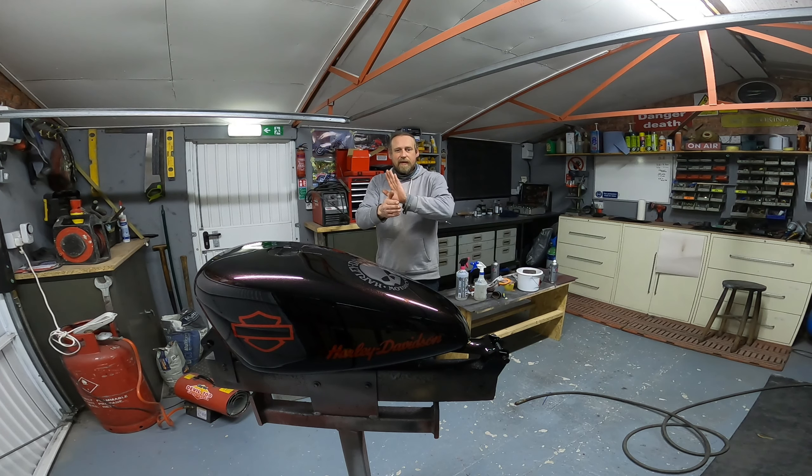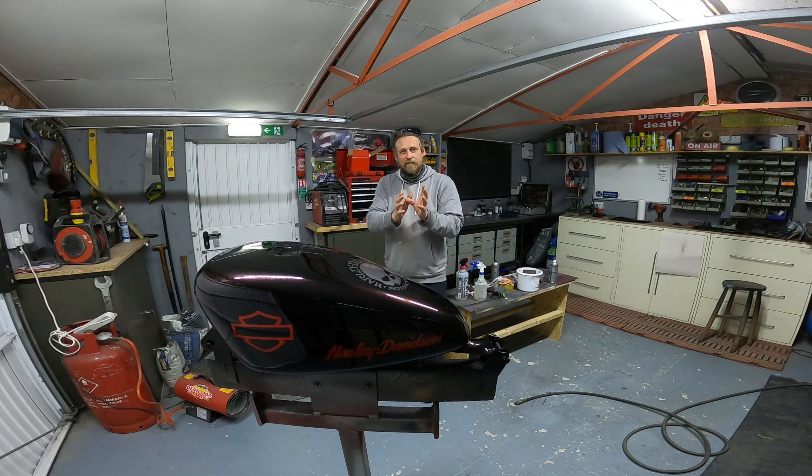We're going to go ahead and lay the second coat on, building the layers up. We do have to flat this down so we don't get any feel from where the script writing is and the bar and shield logos. We have three coats of base coat over the top, and then we laid the sparkle red pearl - the purpley red gold colour you see in the black paint - just before we laid the clear coat. I'm really happy with that. I always try to use just three colours; any more than that spoils the view. You want them to blend perfectly with the colour scheme on your tank.